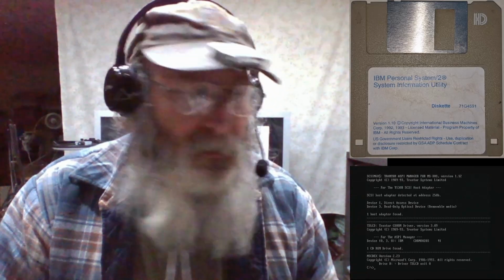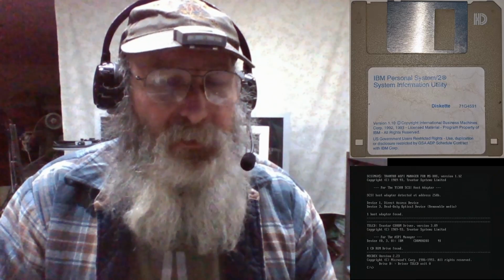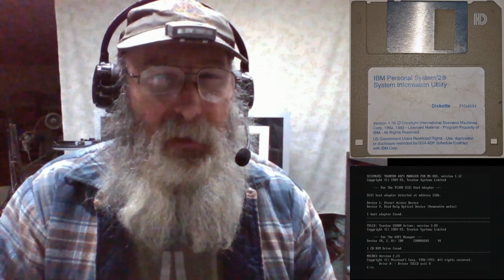And I'm going through in my Visual Basic for DOS and basically creating an enhancement for this, or a more modern program. And you'll see on the Model 30 some of the things that we encounter where it doesn't give a whole bunch of information on this system with the upgrades I've done in some cases, or just limitations of the program. And probably later I'll compare it to how it stacks against the Microsoft Diagnostic, which is the most comparable program. And that was included with, I think that started with like MS-DOS 5 and went into the DOS 6.2 and 6.22 that I have on this Model 30.